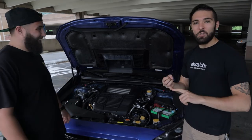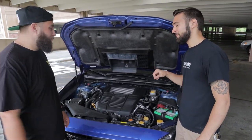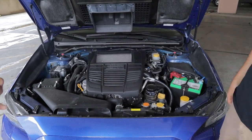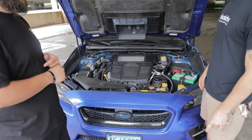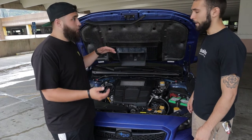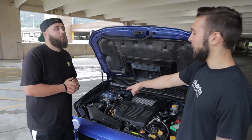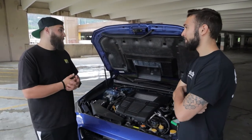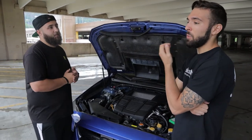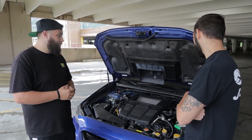Rapid fire: oil change - yes, use a new crush washer each time, or better yet get a Fumoto drain valve. Don't get an aftermarket oil cooler - don't fix what isn't broken. Coolant: go stock Subaru super coolant, or Mishimoto super coolant. Mishimoto also has an upgraded radiator which is a good idea if you're going top mount. For the stock airbox, don't add an aftermarket cone filter - just save up and get a full intake with airbox. GrimSpeed makes one that doesn't need a tune, but the power gain is minimal - not worth spending money twice.